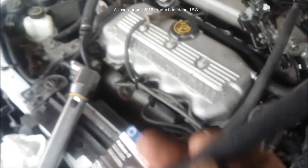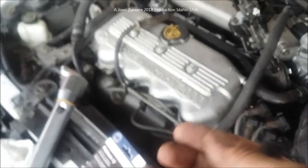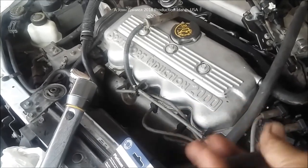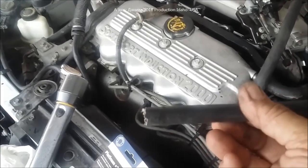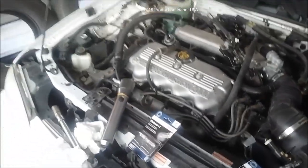So I figured that's a little tip that I'd give you guys. A piece of rubber hose, fuel hose, air hose, something that's got a little softness to it, a little grip, and it'll fit on the end of your plugs, and you can reach in. If you have a 502, like I got in my one salvage motorhome, it's hard to get to the plugs, so you can reach in with your hand, and this is soft enough that you're not going to cross thread it. It just won't allow it to spin. And there you go. Pretty simple. All right, that's a tip from me.